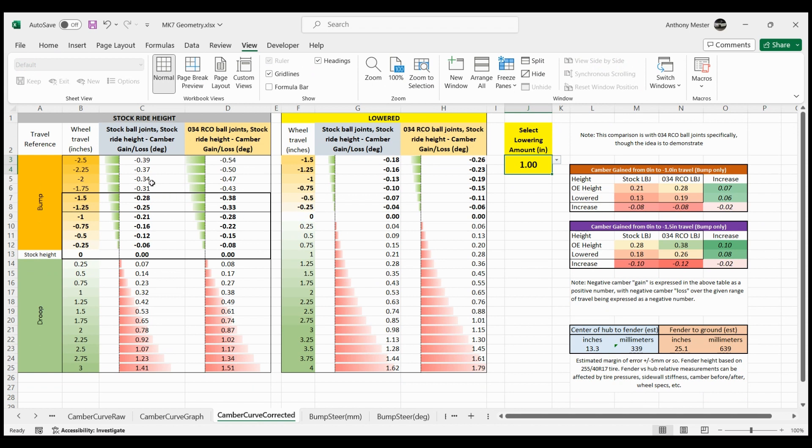Just to reiterate: these charts are strictly for showing camber gain relative to whatever your static camber is at ride height. I will post this chart to the website with a link in the description. Essentially, going from stock ride height to lowered with no other changes — same stock ball joints — doesn't hurt the camber curve, but you're starting off in a different place in it. You gain a little bit of negative camber just from lowering the car. But with an inch and a half of bump travel, you're not going to gain as much from there as you would at a higher ride height — not a big deal, but something to be aware of.